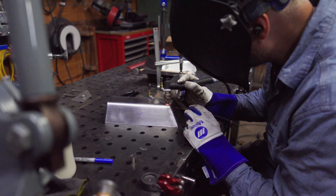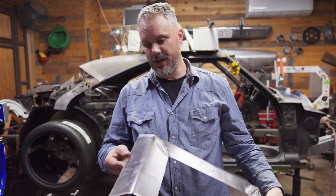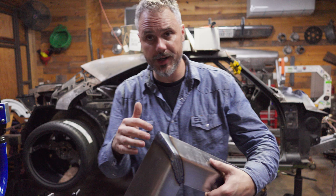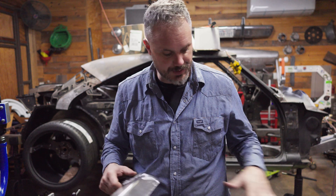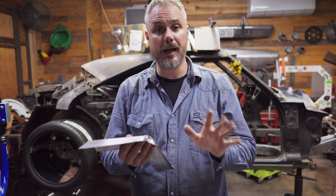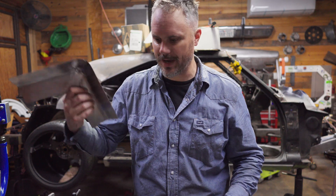I haven't struck an arc in about a month because I just went on that trip, and I instantly do one of the hardest welds — at least for me — which is thin sheet metal TIG on an open corner. There's something about taking a break that helped my brain reset. It's all welded and I'm letting it cool so that my abrasives don't die. I've got a sharp corner here and I want to be able to round it, make it look like it's an original stamped part. Not knowing exactly how to do this, I played around with it and made a test piece to practice the process of making this corner — I made the sharp corner but blended it down the way you normally would, then ran it through the planishing hammer with a high crown die. I overdid this one a little bit, but proved the point that I can round this corner.